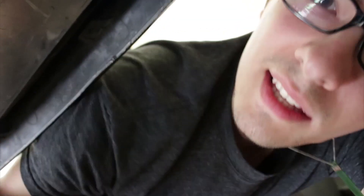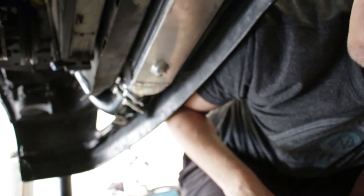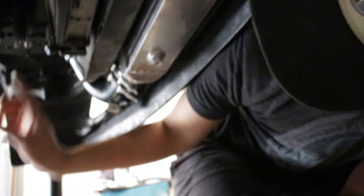This is my intercooler, and this is my radiator right here. This is the plug that you undo — you just do it with like a flathead screwdriver — and then you can just drain the coolant out from here. That's what I'll do real quick.